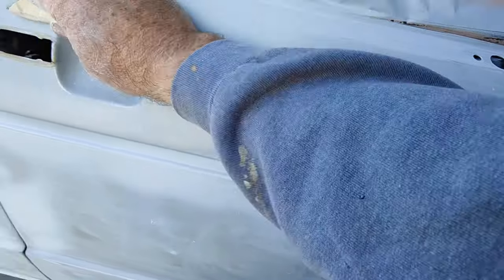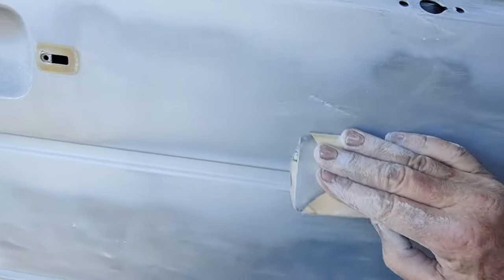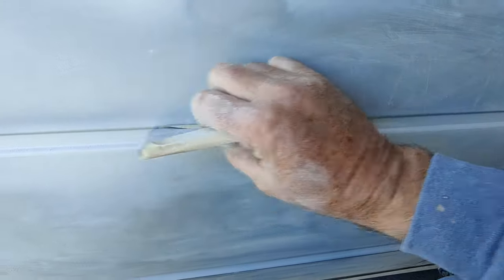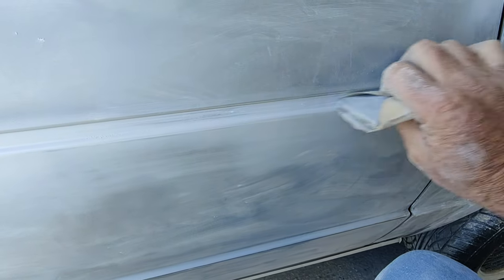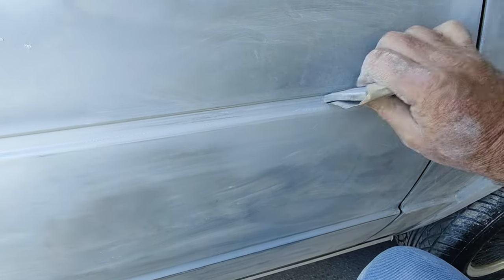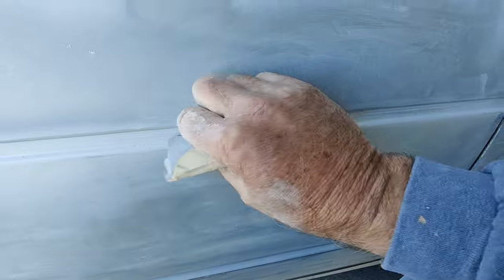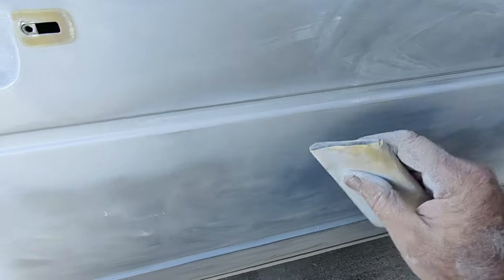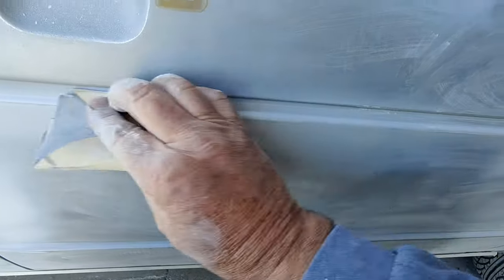After I've done it with 400, you don't have to use that. I've machine sanded with 220 and painted, and it comes out pretty good. Now, the problem is you get your sanding scratches in there. The machine scratches might not show up very much with 400 with solvent base. If you're using water base, none of that. Everything's got to be 600. I don't use it, so I don't know, but my buddies that use it tell me you got to use 600. Most of the guys use 600 final sand even for this too.